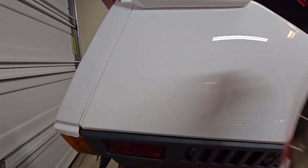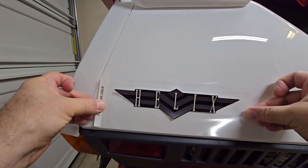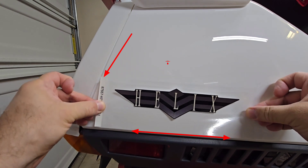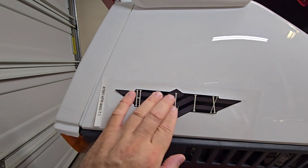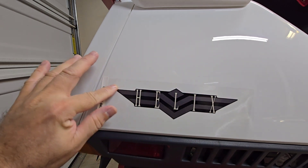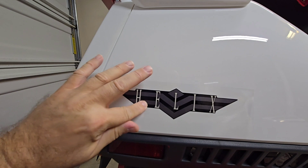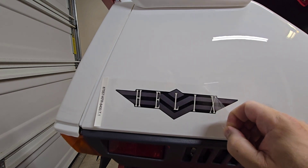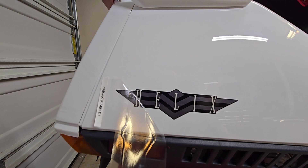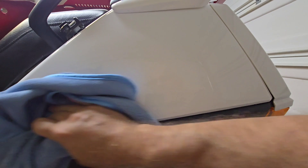These are the only variant left that you can purchase. When you go to put them on the bike, take the far left corner and have it go to where the trunk crease is, then have it go along the bottom line of the white panel — this will line the decal up perfectly. If you do it on both sides you won't have any difference in placement. Don't worry if you get little bubbles on the decal. Don't try to press them out with a credit card — that might rip the decal. Just take a small exacto knife or razor blade, put a tiny hole into the blister, and press it down. It'll go back to looking perfect; you'll never see the hole.